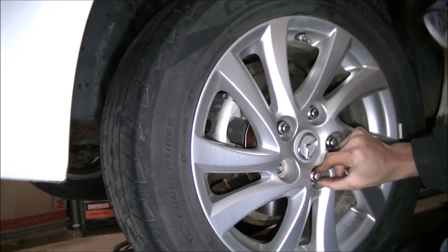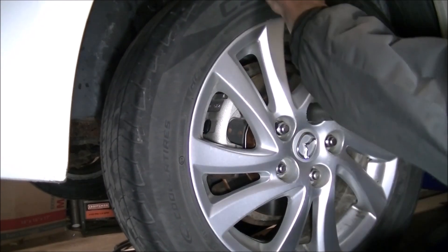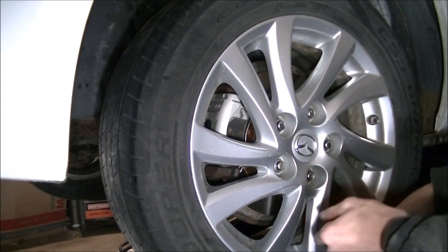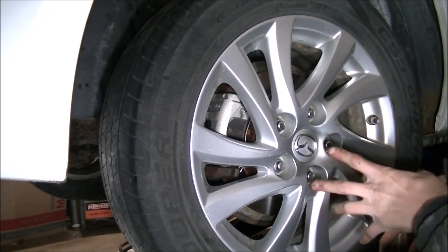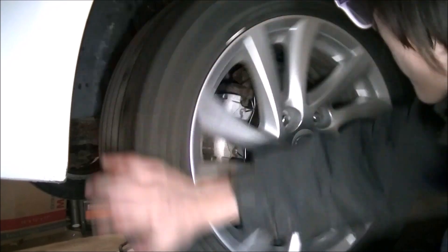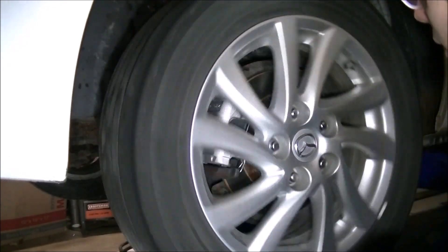It's not that hard to feel a lot better than it did. I've got some drag still, but I'm almost certain if I start driving this around a little bit, it'll go away because the other side still has a little bit of drag as well. Otherwise, this thing is packed up and done. Ta-da! All four are bled out and the car sits a little high now for some reason — well, that could be my new suspension. I do want the elevated height there — ground clearance, because Mazda.